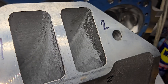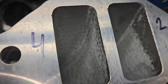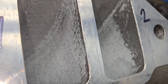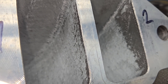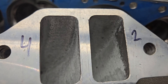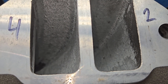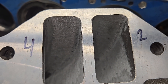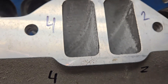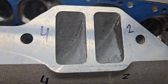There is something I need to show you guys on the intake manifold. As you can tell - I don't know if you guys can see the lines - but the whole manifold is offset cast. Notice I didn't hit this wall with a burr, I barely hit this wall with a burr, because the casting is cast over to the right a little bit too far. Instead of goofing it all up, the final gasket match is going to be done by Just Mopar Joe. You can see how much smaller these are than the gasket line. The gaskets - when I lined it up on the bench - this side was fairly close to lining up and this side was probably a little bit small for our testing, which I'm fine with.